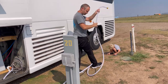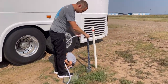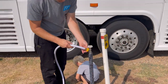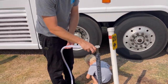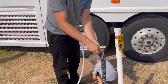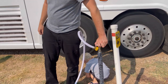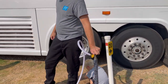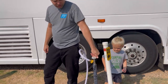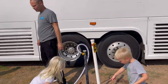Next, run the line over to the water hose connection and hook it up. The spigot here is pointed up at the sky, not really sure why. Get a nice tight seal — again, you don't need to crank on it. You're really relying on the rubber bushing and you don't want to destroy that. At that point, turn on your water all the way.